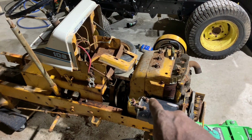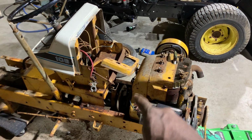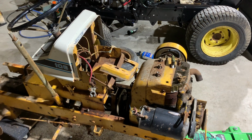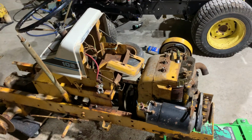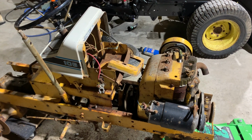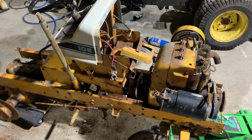the drive shaft. Actually, it's not connected to the engine, but this clutch disc is connected there, and I've got to pop those cotter pins out, and they've been a little bit difficult. So I'm probably going to have to put the air hammer on it tomorrow, and probably go visit my brother and see if he's got some different air hammer bits, because I don't have enough of them. Maybe I'll get on Amazon and order some.